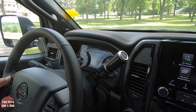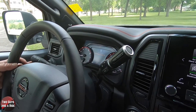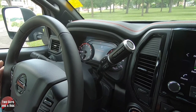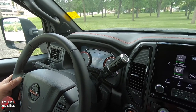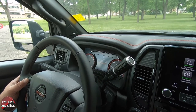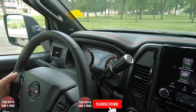Turn indicators: you have the three-flash to pass — when you just touch the turn signal without clicking it all the way, in the lock position it'll flash three times and turn off. Pressing enter turns that off. Locking: you have the I-key door lock on or off, selective unlock on or off, the answer-back horn so when you hit lock the horn will sound, and auto unlock when you shift into park — a nice feature for passengers.